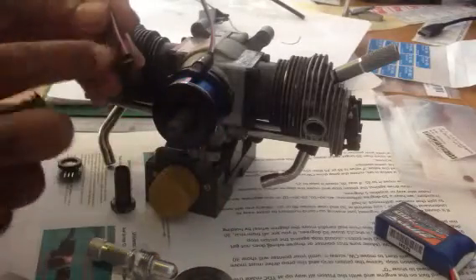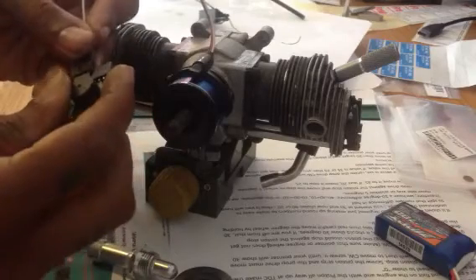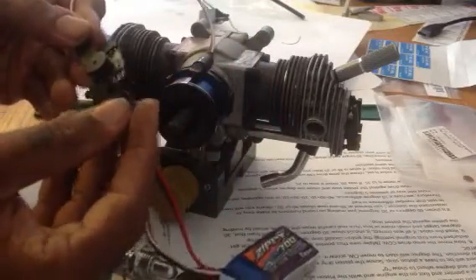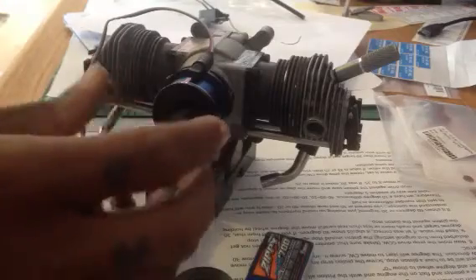What I'm going to use now is the timing device. Plug it into the sensor — make sure the white or remote wiring is on the inside of the device. Then plug the battery in — either way goes, it doesn't matter, it's universal. All I'm going to do now is rotate the magnet ring anti-clockwise.